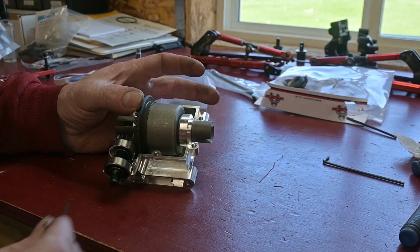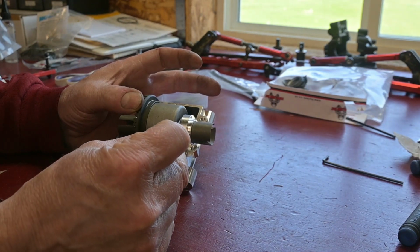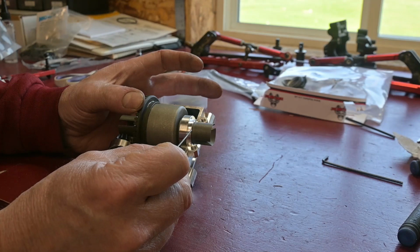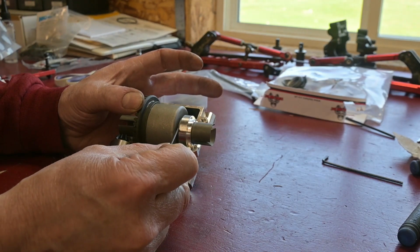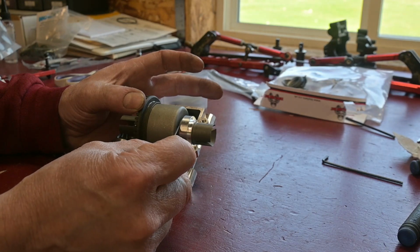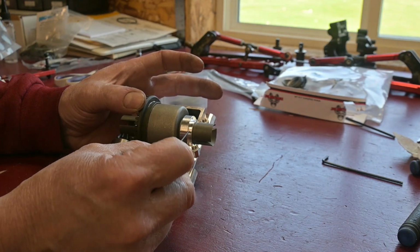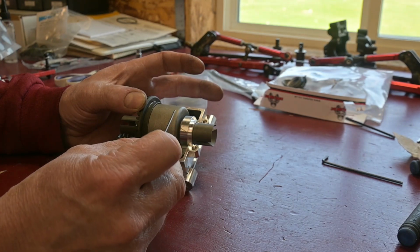I'm going to start by trying to machine that face off down there, I don't know if I'm going to be able to see this in the camera, to force this whole differential assembly back this way. If it goes back a millimeter or so, it should drop in there. I think I got enough material in there to face that off. Leave a little ridge for the inner race on the bearing that's tucked down inside of here to catch, and still have clearance so this is not hitting this.